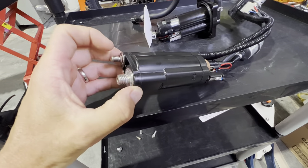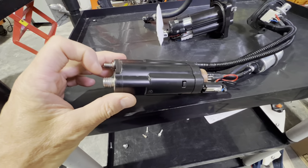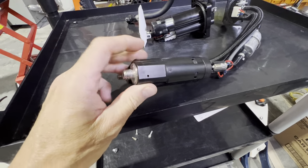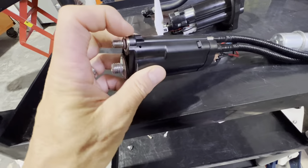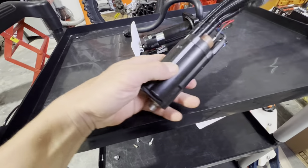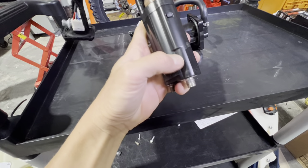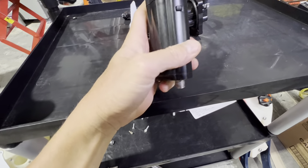This is the pressurized outlet. The pump motor itself draws fuel through this little hole right here — there's a hole there and another one on the other side. So this is sucking in fuel through these two holes. Or if the tank is at a higher level, gas is spilling in through these cracks up at the top. And when your tank is running low, it's pulling in fuel from this bottom hole right here.